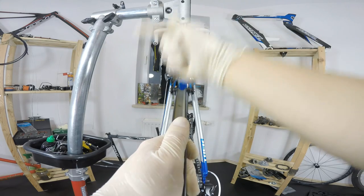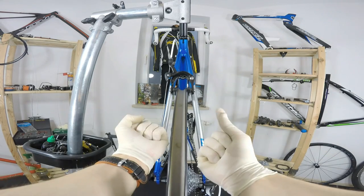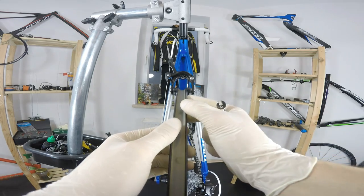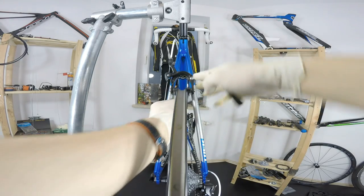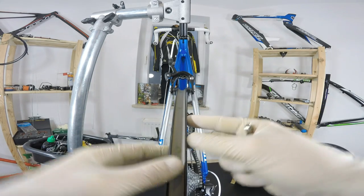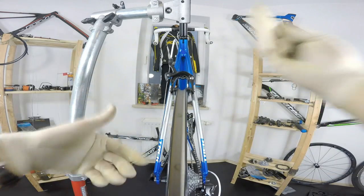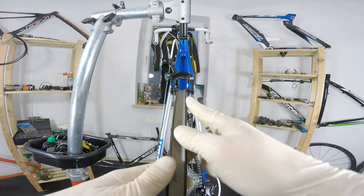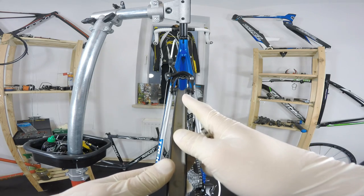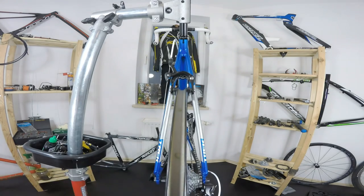If you just hit something on the road or in the terrain and your rim goes down, remember that your spokes are only pulling. They will not be able to push it out. So sometimes putting some more tension just around this spot would help you, and releasing on the same spot would help you with some other miles when you're riding, just to get the wheel working. But it will be difficult to make it 100% true if it was hit from above.